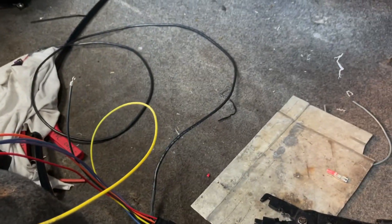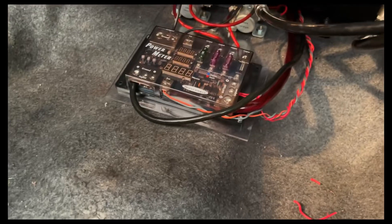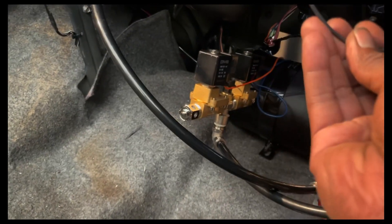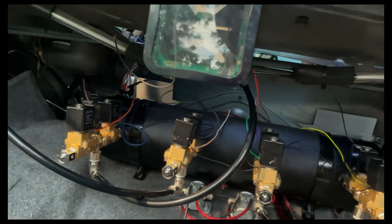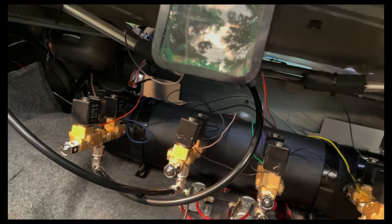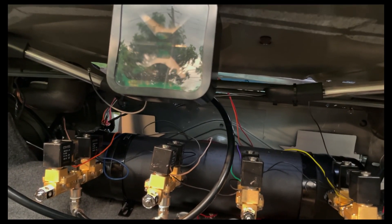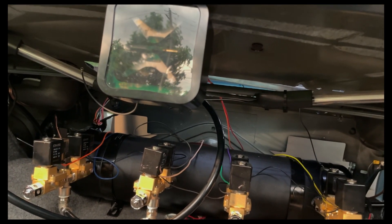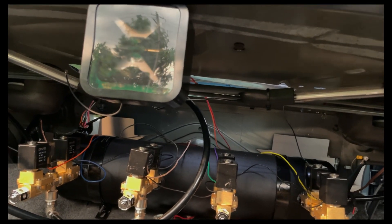So I won't be using the yellow wire and the orange wire for now — actually I ended up running the orange wire as the remote wire, and the red wire is the main hot. The other wires I won't use: one is a light wire that dims the controller when you turn your lights on, another has to hook to your brakes for some special feature I don't know about, and the last wire goes to the relay for the pumps. I'm gonna use the old pressure switch and keep that like it was.